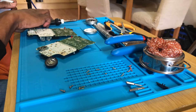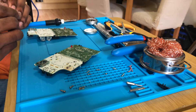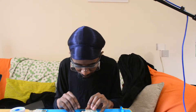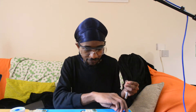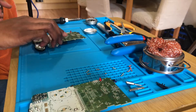There we go — that's done it. Right, good. Because I know that's the way it came out, I can put that into the new one. What's great is that I might not need flux to solder it in because it's wire on a through-hole component. But let's see. So that should be done — the speaker's in. I'm going to turn the heat down on this because I don't need it to be as hot anymore.